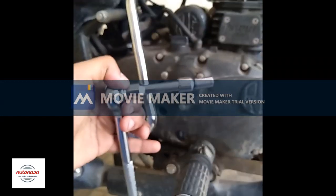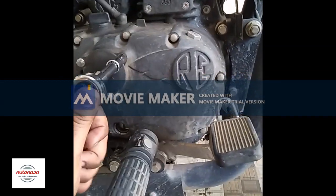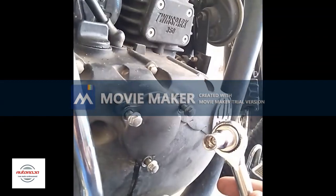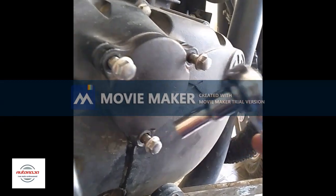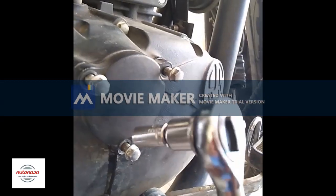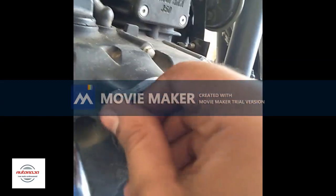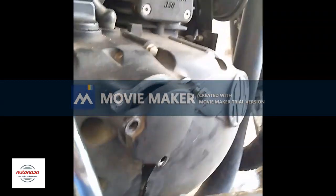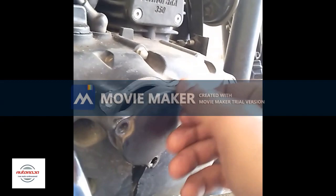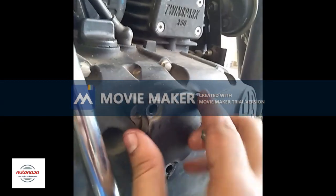And here we are planning to remove the oil filter which has to be replaced. I'm using an 8 mm socket wrench. I just loosened all the screws. I just have to remove it with hand now. So basically for every 3000 kilometers you are supposed to change the engine oil. So that is what Royal Enfield recommends. But for me, in my case, I am changing it every 4000 kilometers. I think that should be fine.